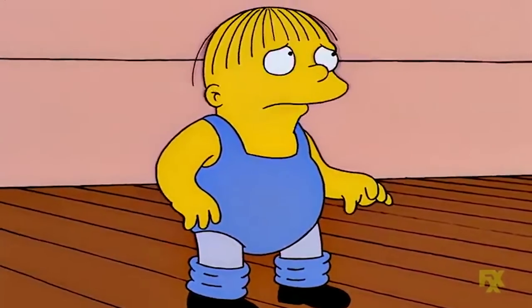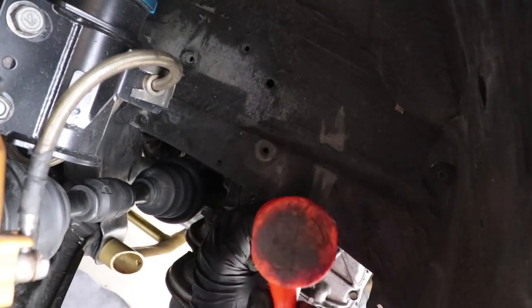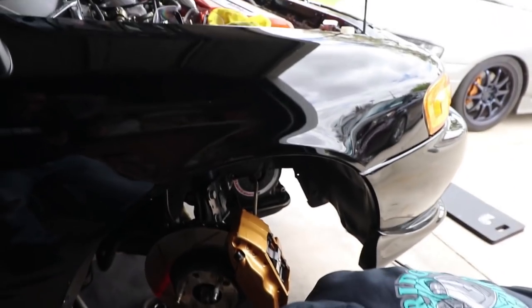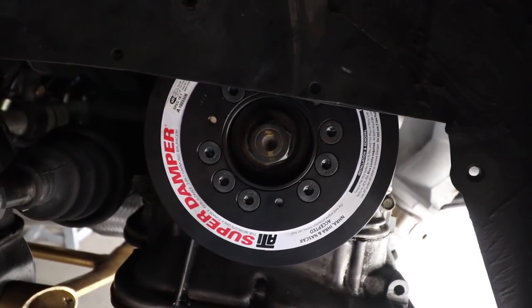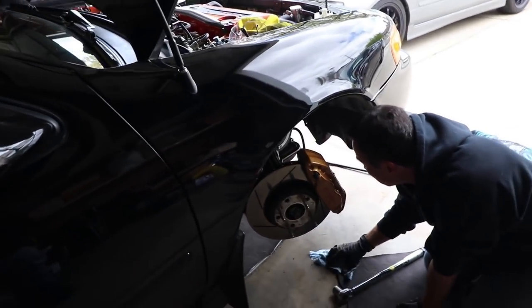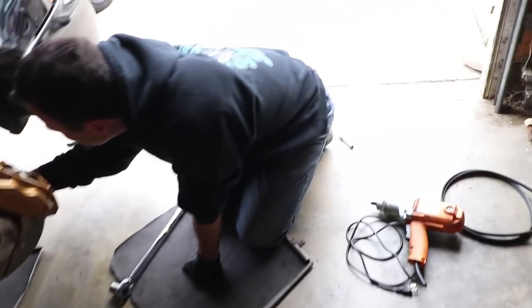He's just got a big socket on the end to go ahead and tap it in flat. That washer in the back will keep it from going too far. We want to stay flush with the surface and then he's good to go. The pulley is in — we went ahead and pulled it all the way and it's all good. Now Rob's going to torque it. We're going with 112 foot-pounds as I found on Google. Everything went in nice and smooth with no hiccups. I'm going to press on the brakes and put the car in gear just to hold it enough for Rob to get that click on the torque wrench.